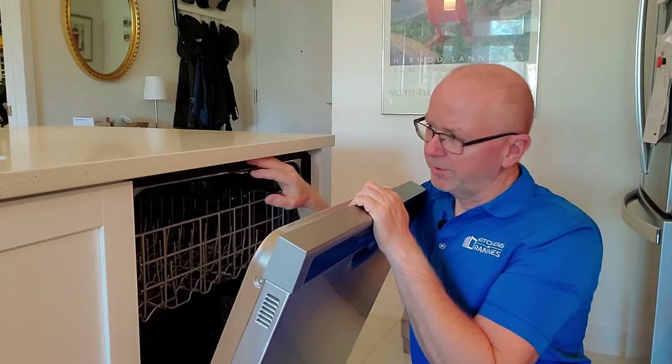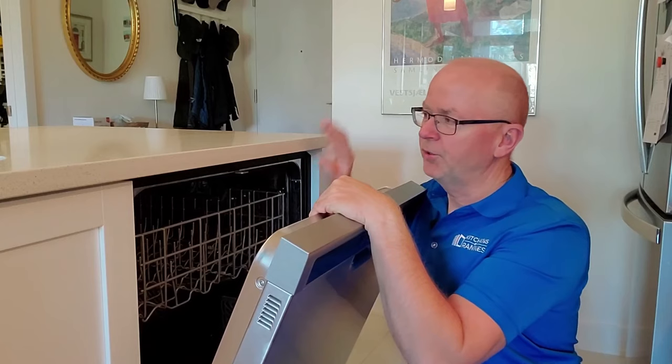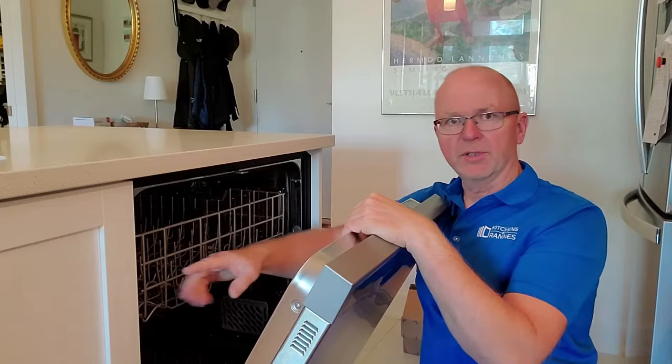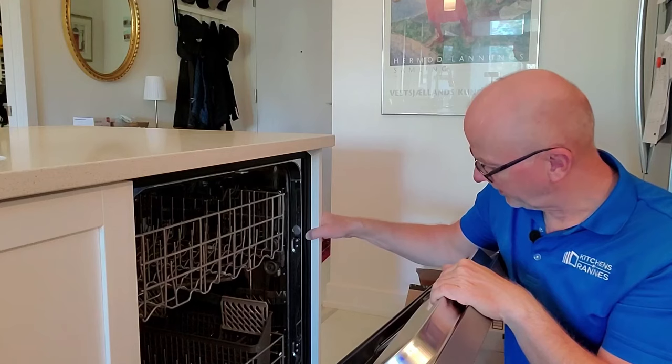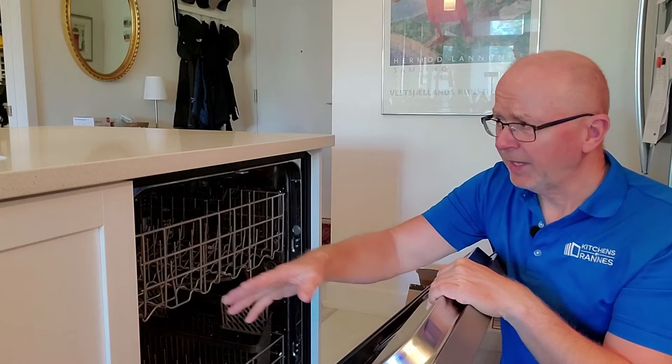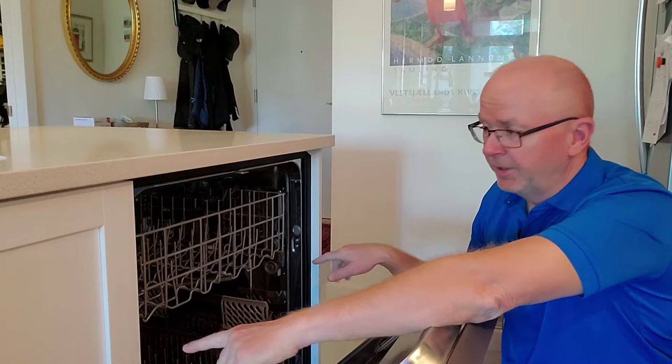I've heard installers say they've got nothing to connect it to up top, but that really doesn't matter. With a quartz or granite countertop you secure the dishwasher from the side. Behind that little plastic cap there is a screw that can be fastened into the side panel, and on the other side it goes into the cabinet. If your dishwasher has those small flimsy metal brackets on top, in many cases those brackets can be repositioned down lower so you tie the dishwasher into the cabinet from the side rather than the top.